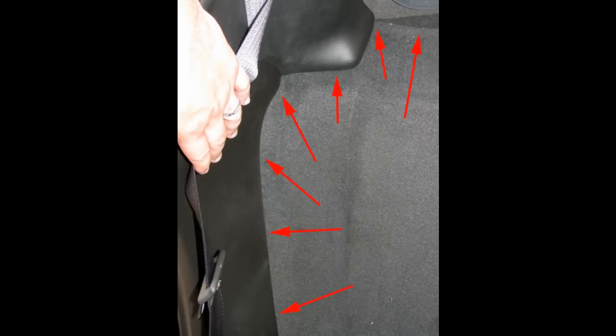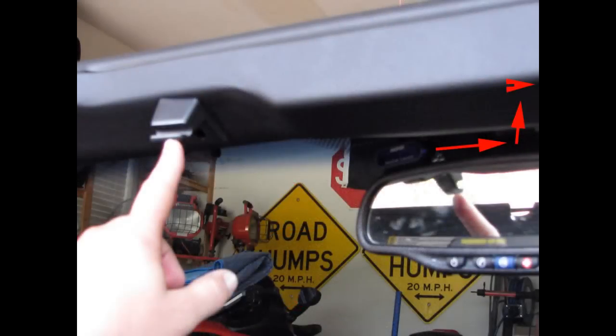At this point, once you reach the plastic, when you're about to go down the back, that's when you're going to want to join it up to your other two wires coming from the trunk. And then, of course, use zip ties to keep them all together, or wire looms, or however you prefer to join your wires together. Run them along the kick plates up to the front. The target location for all this will be the big circuit board area up under the console on the passenger side. All right, let's cover the display.